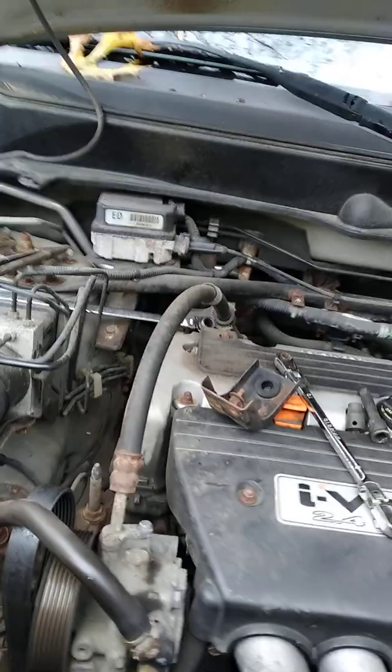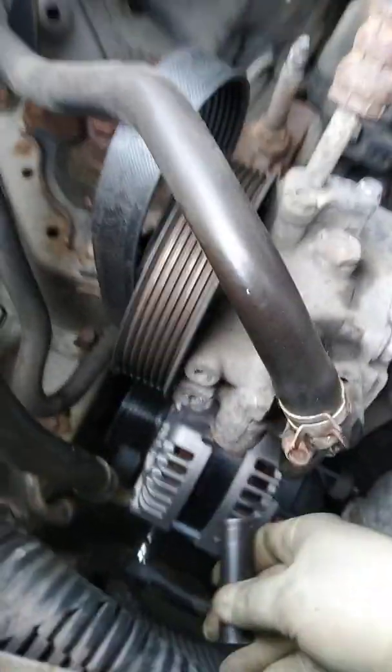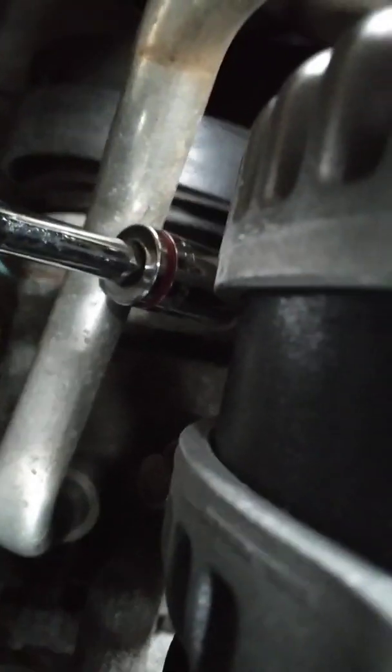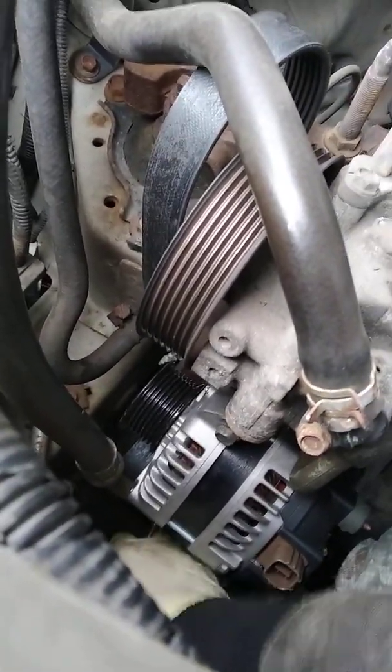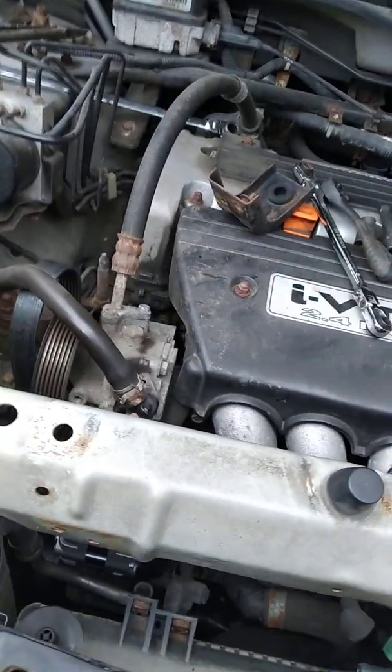Things you have to take out of this car in order to fit the alternator in there — you're going to need a number twelve socket. There are two bolts on the bottom, as you can see where my extension is right in there — that's one, and there's the other one. The AC line is actually hitting, so I use a three-quarter extension.